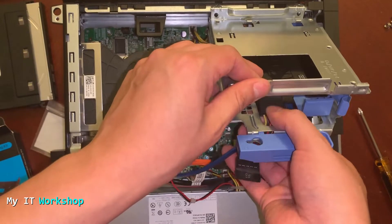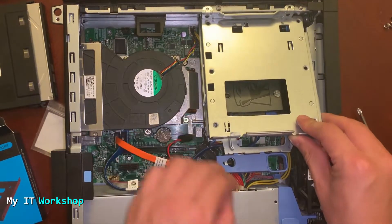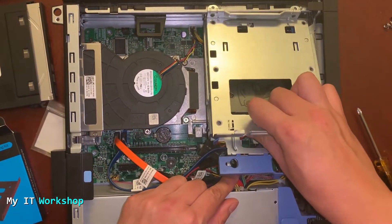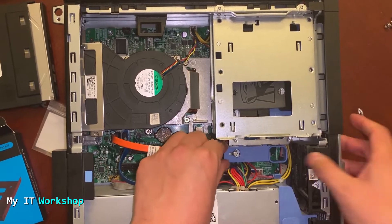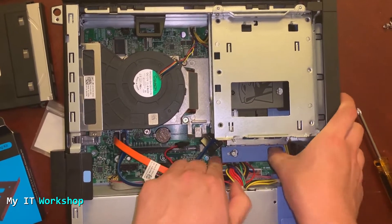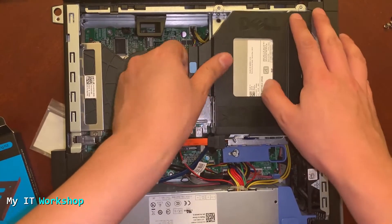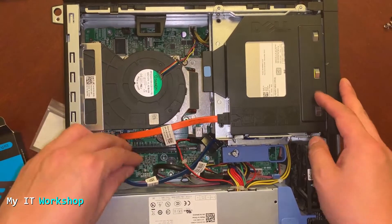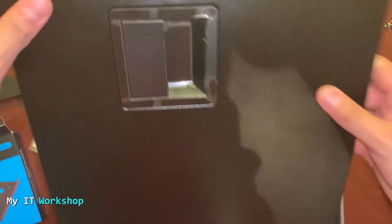As always on this channel, I struggle when connecting hard drives with power supplies and all that. If your power supply is not working for this model, I have a video for that — I'll leave the link in the description below. Now that we have connected it, we're going to make sure we've freed the SATA and power for the CD/DVD reader. We're going to secure and lock it so we don't have any accidents when moving this desktop computer. We're going to put the CD/DVD reader back in place so we can reinstall Windows, Linux, or whatever operating system you like. Then put the cover back — and that's pretty much it.